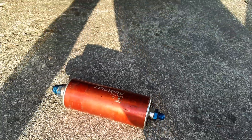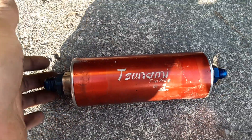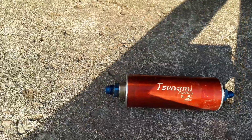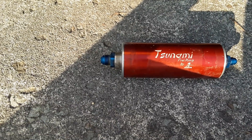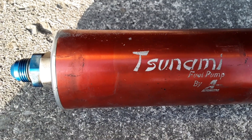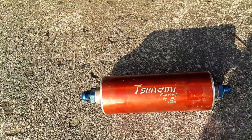Time for a fuel pump swap. Everything I've tried to do to tune this thing — it keeps running lean. I'm using 80% injector duty cycle, which should be enough for like a thousand horsepower with those injectors, and the car is still lean on just six pounds of boost. I bought a new fuel pump. This is the old one, an Aeromotive pump, but at the pressure I'm running it's probably only good to five or six hundred horsepower.